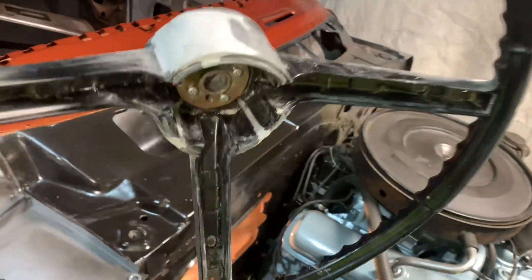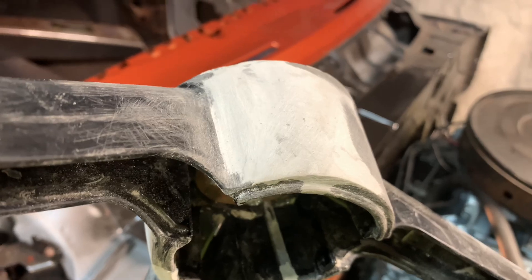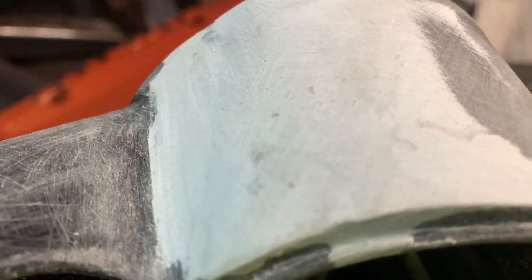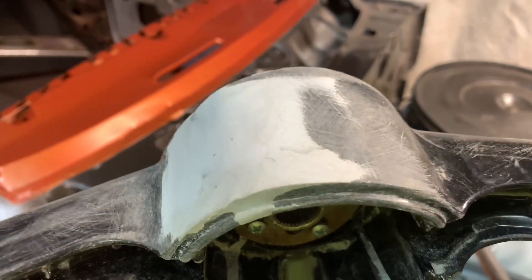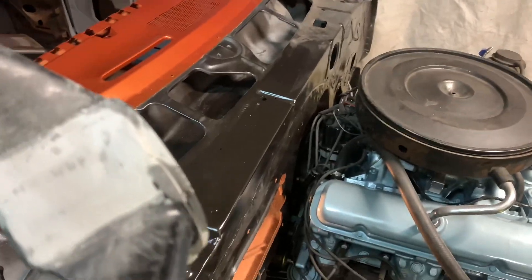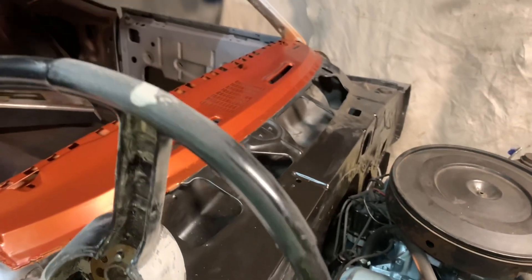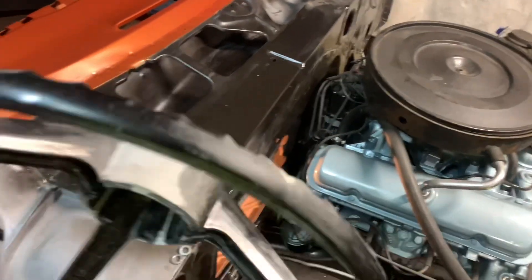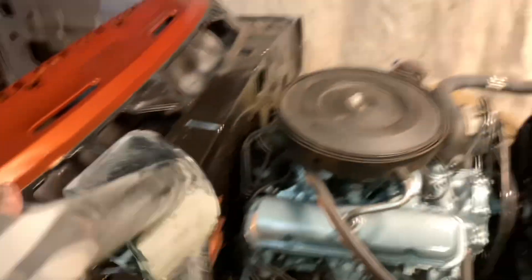I let that stuff cure and I've got it all sanded nice and contoured really good — we're really close where it needs to be shape-wise. That stuff does sand like I hoped it would. But you see little blemishes in that finish there, so we're going to put a glaze coat or body filler on top of that, just a really thin coat to fill in the blemishes and sand marks. If you look carefully at the rest of the steering wheel, all of the cracks — even the ones on the outside edge — all got the same procedure: grind them out, groove down as far as it can go, fill it full of epoxy, and sand it all back to shape.